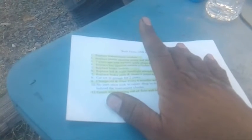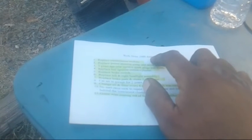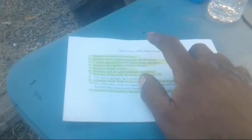For you guys having problems and having no shift problems, and you changed out computers, you changed out wires, you changed out practically everything that you can possibly think of, the one thing that you probably forgot to do, and it has to be done with all Dodge, Chrysler, Jeep, and so on that's made by this particular brand, everything has to be reprogrammed.